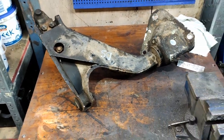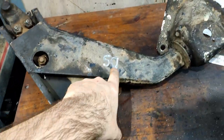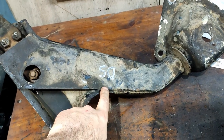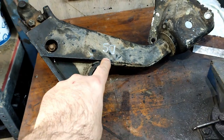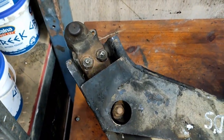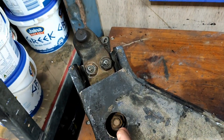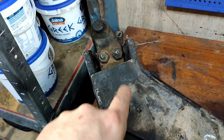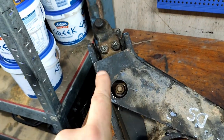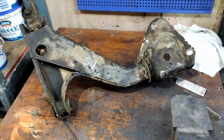Just got the arms separated from the struts. The other one's over there so I can trip over it later. You'll see I've conveniently written 'DS' on this — that's for maximum confusion, because this is the passenger side. These need to come off next; I don't have these yet. There are different ones of these — there's ones that are curved and ones that are straight. I think the straight ones are for manual steer cars and the curved ones are for power steering cars, so I need to make sure I get the right ones when I order.